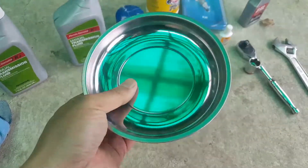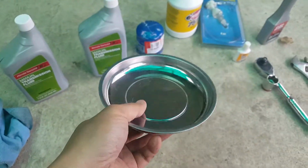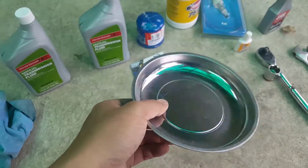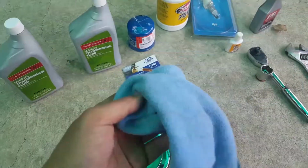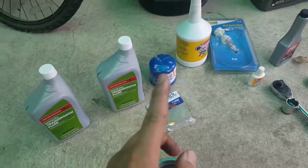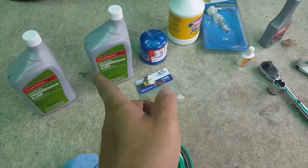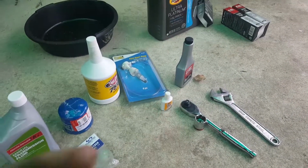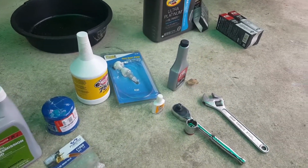That kind of indicates the condition of your transmission. If you have all these metal pieces coming out, that means something is definitely wrong with it. Maybe the teeth of the gear are broken off or something like that. And also you need a rag. So yeah, that's basically it. And later on, in the next video, I'll be showing you guys how to change the transmission fluid right here. I got this transmission fluid for free from the Honda dealership, and also motor oil. I'll be doing it too. Alright, I'll show you guys the finished product afterward.